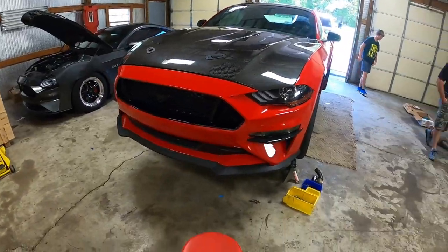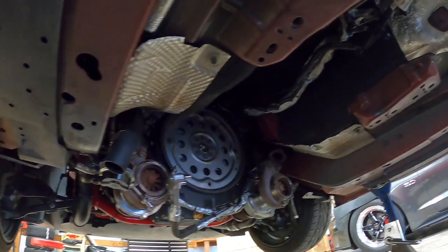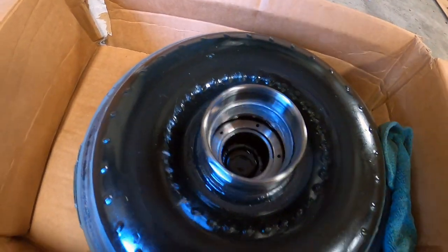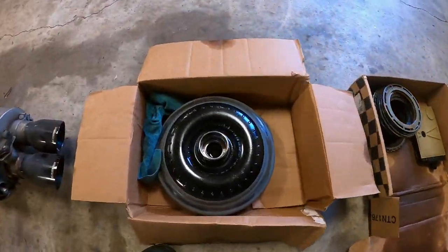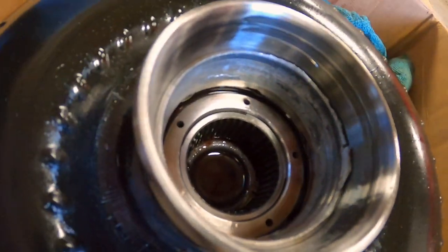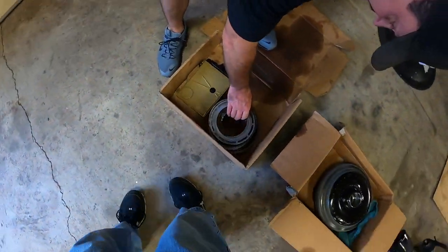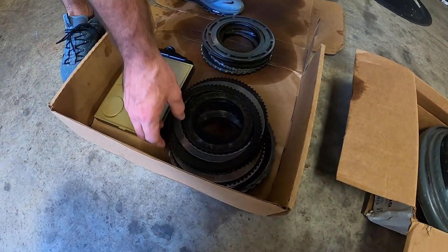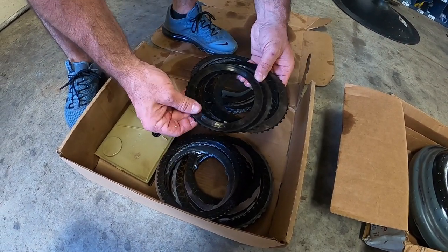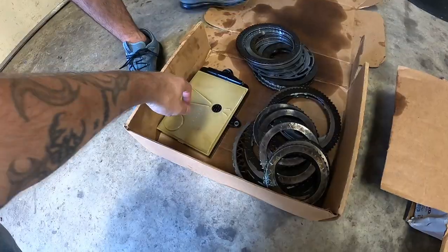What's going on? How you doing? Always on jack stands - there's no transmission, look at that. So you could get it out with the turbo still hanging - that's good, I didn't know if it would have to actually come out or not. Did you see anything weird with the clutches? There's some burning but not very much at all. I think the D clutch was the only one that really looked bad. You can see just one of the steels is burnt there - a little brownish - but the rest of them look good.